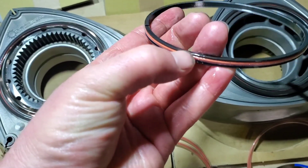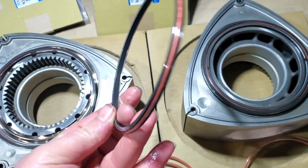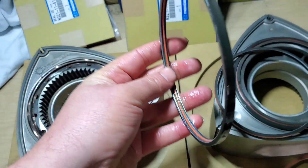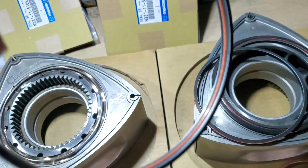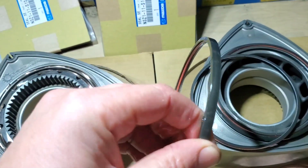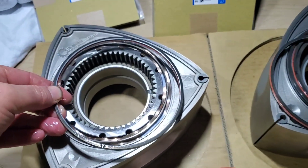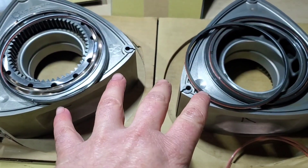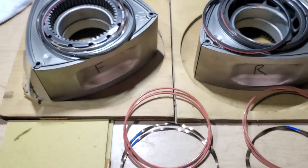It's not loose. And then for the secondary outer, the O-ring resides on the inside channel. You can see it's not bunching up in excess, and it is not loose in any way as far as fitment. So we're looking very good. We'll be pressing these down in, and then that will be the final rotor parts installation for rotor assembly pre-assembly of the motor.